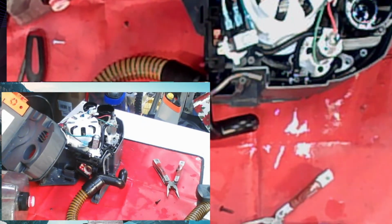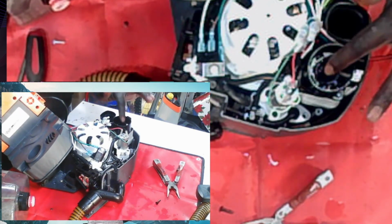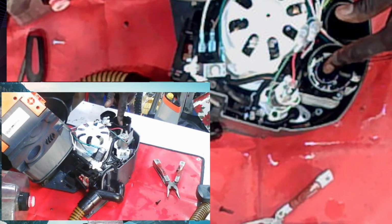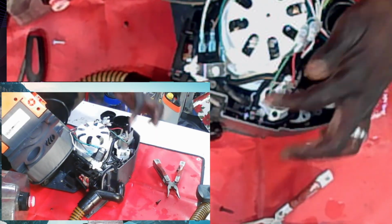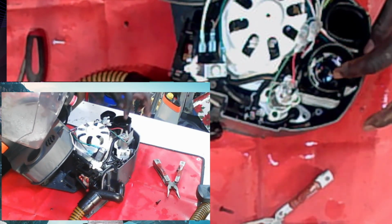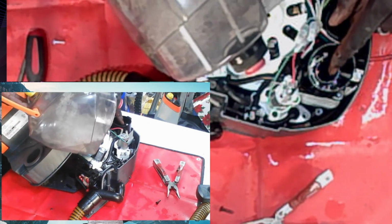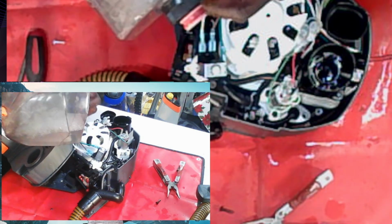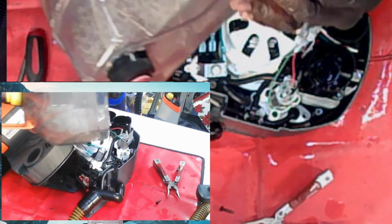So let's say you put your tank on here to diagnose this thing, and no water is coming out through that little section right there. Then that means your auto receiver is not receiving the water, or your tank is not giving the water. Normally it's either because the tank is warped, and you would check to see if you have a flat surface here.